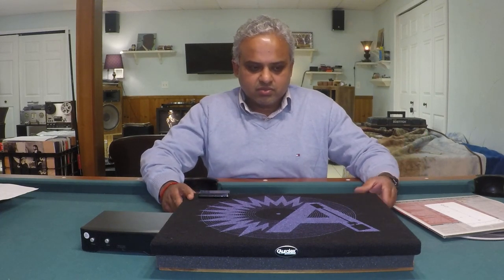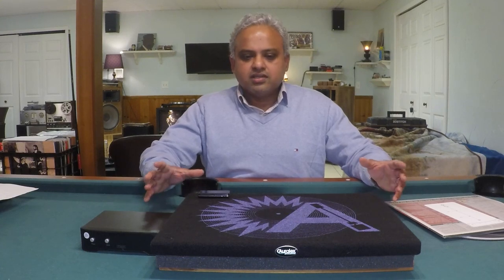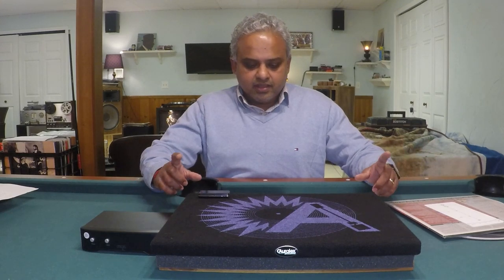Platforms like these act like a mechanical filter to reject those very low-frequency vibrations from reaching your turntable, tonearm, and cartridge setup. They prevent those vibrations from exciting the cartridge, because the stylus riding the grooves of your record cannot distinguish between picking up the serrations of the groove versus external vibrations like footfalls or appliance noise. A mechanical filter keeps those low-frequency vibrations from entering your turntable.